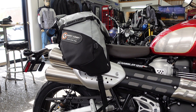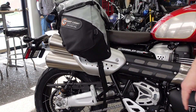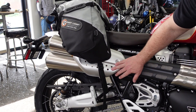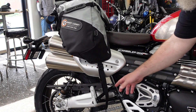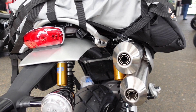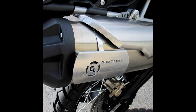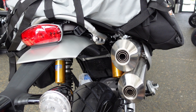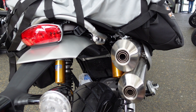A question we get a lot with Scramblers is: will the horseshoe-shaped bags work, and how does it work with the single-sided exhaust? I've mounted the Great Basin here as an example. The Great Basin has mounts in three places, one on each side. It's normally identical on both sides, but not on the Scrambler because it's asymmetrical — this strap goes right to the passenger foot peg, and as you can see, it just rests right on top of the factory heat shield. It's the same on the other side, except there's a foot peg with no heat shield. If you're worried about exhaust clearance, as long as your bag is not coming in direct contact with the exhaust, you should be fine. All of these bags come with one of our Hot Springs heat shields, and there's plenty of clearance here for adding one for extra peace of mind. This bag is not resting on the pipe — even if full, it might sit a little lower, but I think it's very viable to run this horseshoe-shaped bag on the Scrambler.